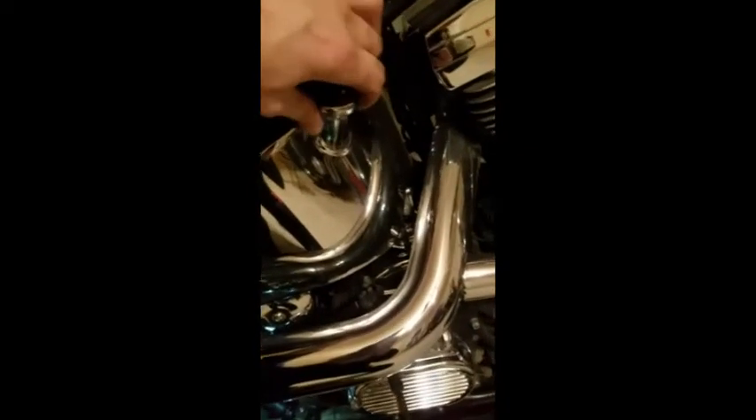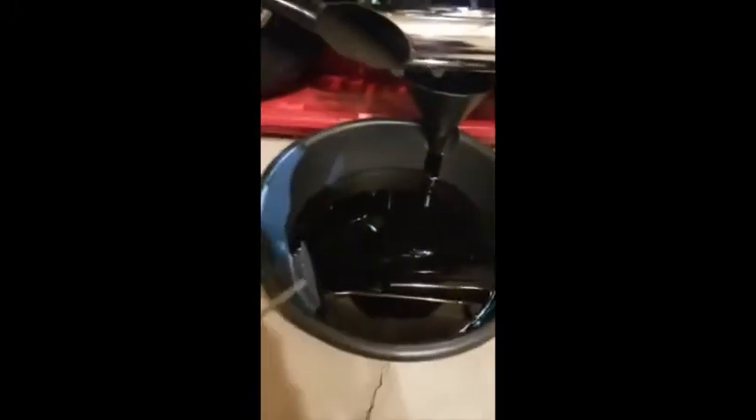I've loosened up the tube bracket and now I'm going to pull it out of that little clamp and slide it right off to the side. I'll drop it down below where I've zip-tied a funnel to go into my drain pan, and pull the plug right out of the hose to drain. I've pulled the hose clamp back, pulled the filter off, and now the oil is draining down into my funnel into the oil pan. Now I'm going to come up and release the dipstick so the oil can drain much better.